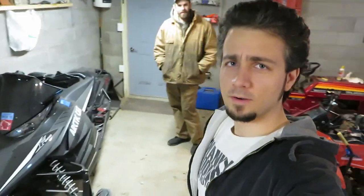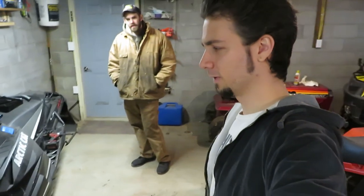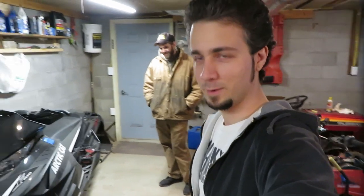All right, what's going on guys? We are in my shop with Crossfire Jason. We're gonna be working on my sled. If you've seen any of my videos in the past, you've probably seen one where I blew a belt - and that's not because I only put three videos out. I blow like five or six belts a year. Today we're going to address that. This low-powered sled shouldn't have this issue, but the bigger higher-power sleds from 2012-2013 all switched over to the big fin secondary. I put a small fin secondary on there, so we're gonna pull that off, switch out the helix with a used one I bought, put it back on, and if we ever get some snow, we'll test it out and see if I keep blowing belts.